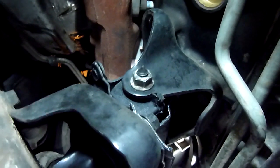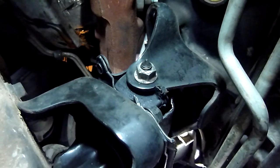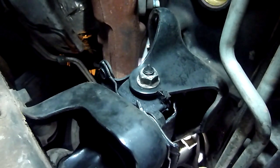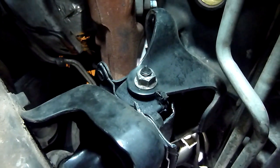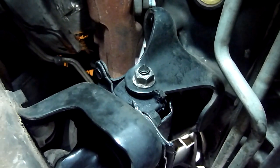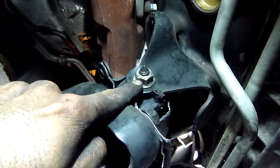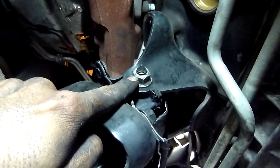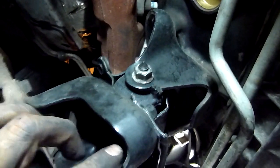That's about it — I thought this side would be easier but I had some alignment issues that ate up some time. It's fairly easy to do; just be prepared to spend some time, and if you get frustrated, walk away, come back, rethink it, and get it done. According to the book, one bolt is supposed to be 50 foot-pounds torque and the rest are 37 foot-pounds — I can check that for you.